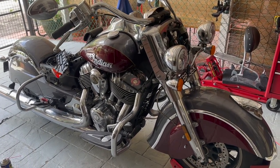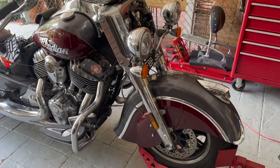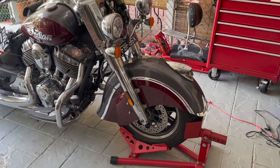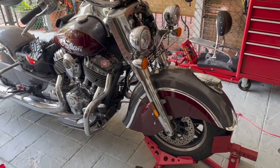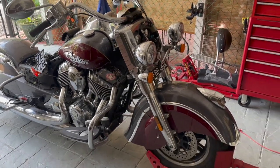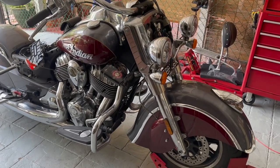Now they've just not been working at all. Before replacing the sensors I went ahead and cleaned them thoroughly — front and rear — with contact cleaner, since sometimes dirt can cause faulty signals. But that didn't work either, so I'm guessing my speed sensors are faulty.